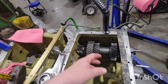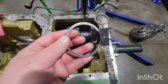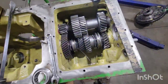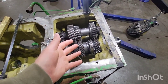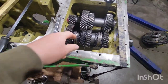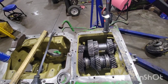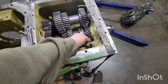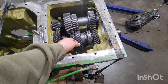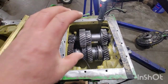With the dummy tool it's easy — you can slow down and do a good job. You've got the tool to hold the snap ring open with wire hooked to each tool. You just reach through here with a C-clamp, hold the gear in place, and start building the shaft as you bring it through the front. I take a picture of the parts page on jdparts.com on my phone to get the orientation right — snap ring, thrust washer, then inside: thrust washer, snap ring, thrust washer. Sometimes gears have a recess or notch inside the splines, meaning that side goes against a snap ring.